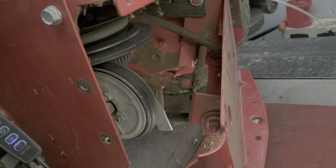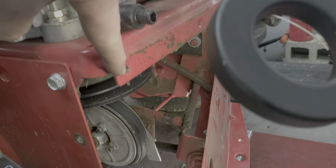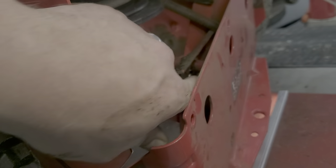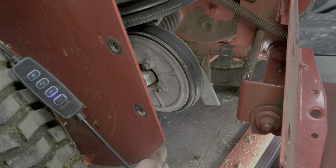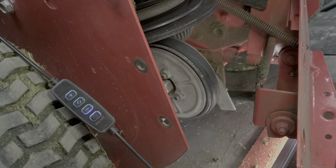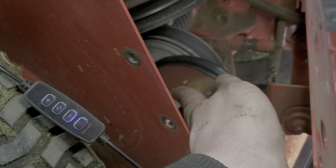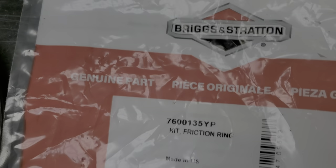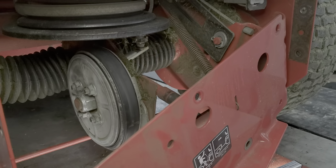I've got the back taken off here. If you want to take it off for a better view, it's just a couple of half-inch bolts all the way along the side and then the top, and then a couple of 9/16 bolts that hold the bracket. Nothing really falls out of place — it all goes back together pretty well. Otherwise you can get to it from the bottom using a right angle and zip the four nuts off. The part number is Briggs and Stratton 7600135 YP.